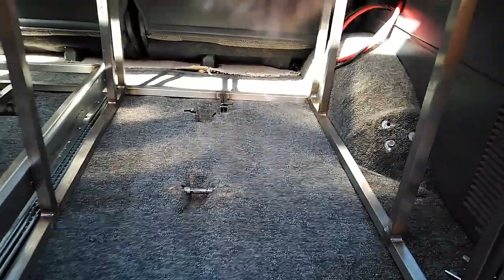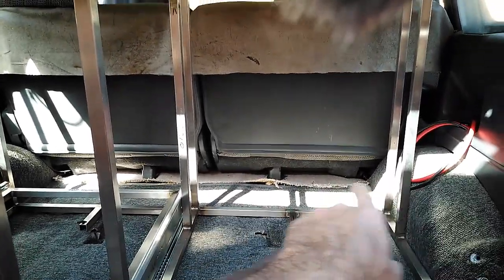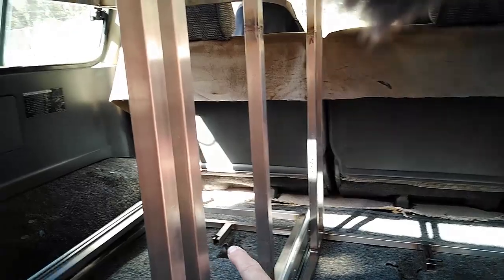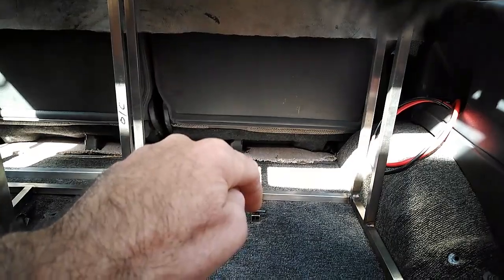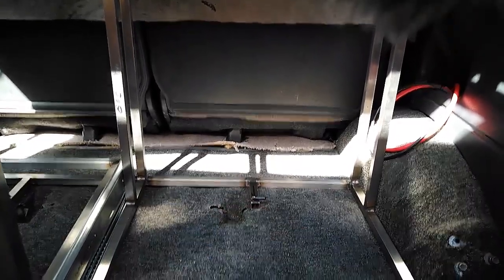In previous drawer systems that I've seen, they mounted it to the floor of the Landcruiser via either adjustable turnbuckles or something at the back, catching the cargo mounting brackets inside. But what I have done is, for the rear, the third row seats, when they are folded down, there are little places you can see over there, over that end over there, where the seat actually clips onto. I've removed those brackets, and now I'm going to be using the bolt holes to catch those little tabs that I've mounted or welded to the frame. And the holes on top will be much bigger than the holes on the bottom of the tube, so that I can get the head of the bolt through there, and I'll be using Allen cap screws, so the bolt itself will be recessed inside the tube and not stick up above the level of the tube, catching the drawer as it slides in, so they'll be absolutely flush.